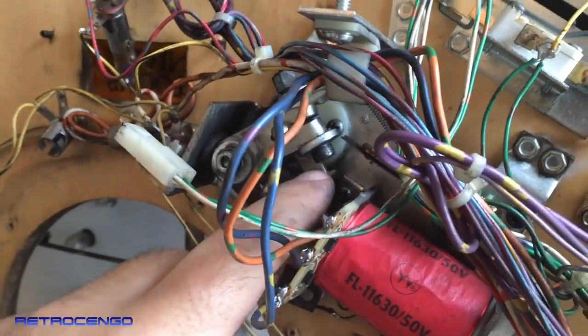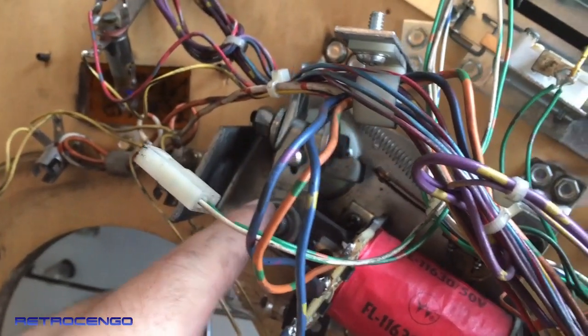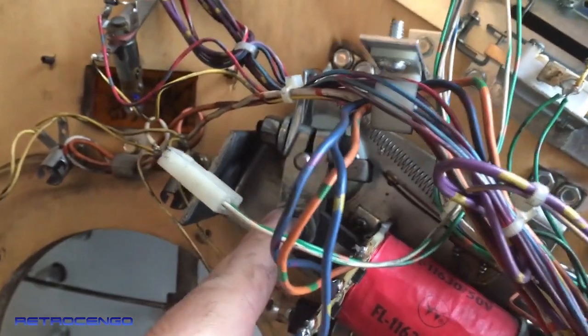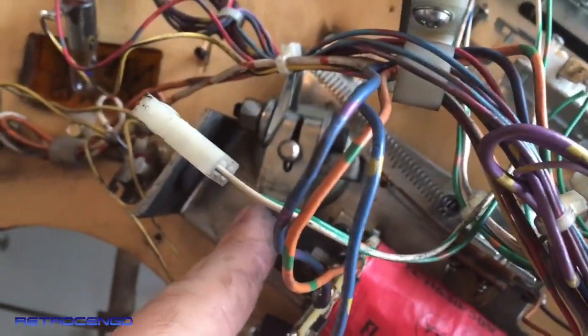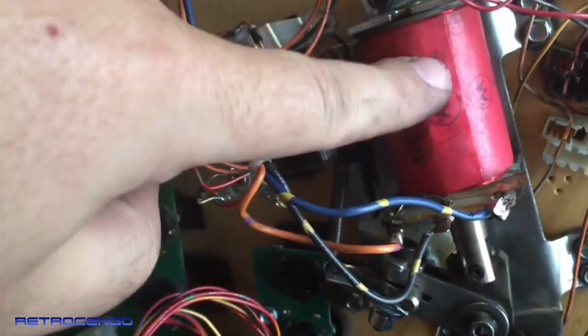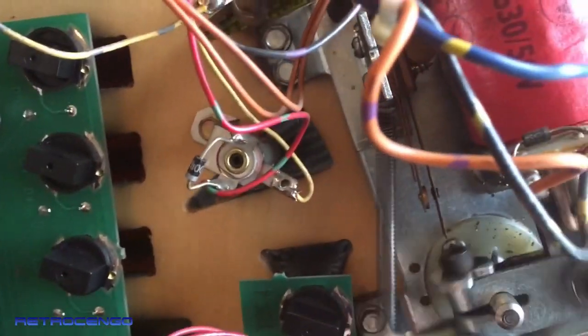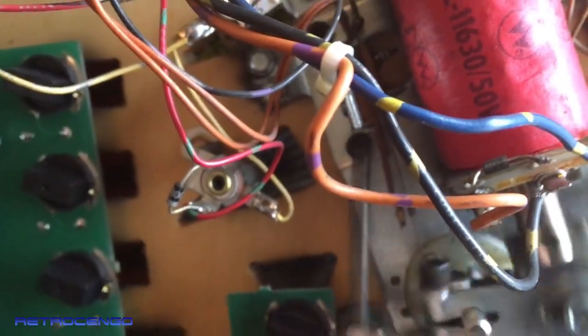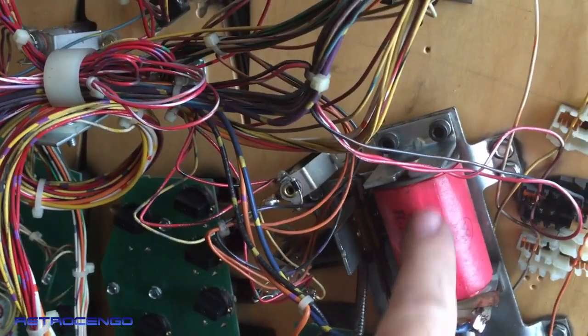Now, can you see this little metal part? That's the part that will go in and activate the end of stroke. Can you see that? It makes an error when I turn the game on and says the end of stroke is not activated. And look at this, that metal part that should be down there and push these two leaves is broken off. So this coil has got a really hard life.